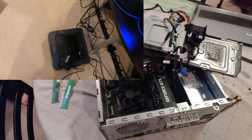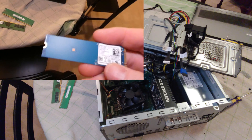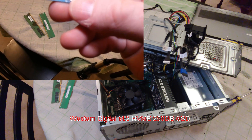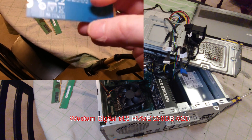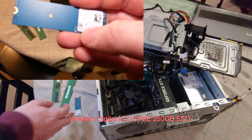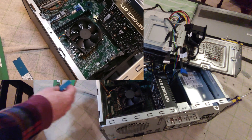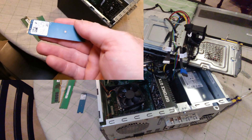Here is the M.2 drive. Trying to remember the brand — surprisingly it wasn't an HP EX900/920, which is a really slow drive. So I put in a Mushkin Helix 500GB M.2. Not only did I double my storage capacity, but the speed is significantly better.